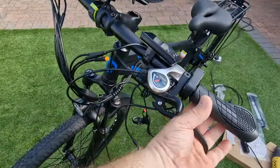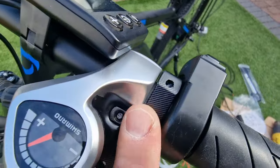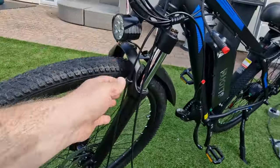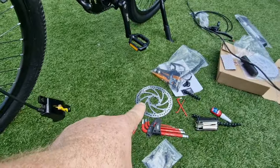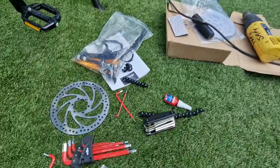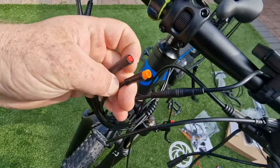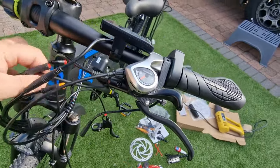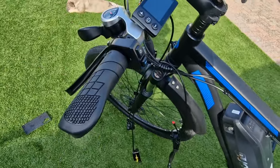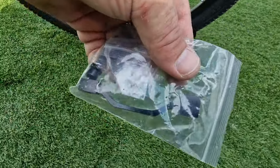It's really straightforward. We've taken the side off and put the new lever on — the lever assembly has a carbon fiber look, feels nice, with a really positive action. I have the spacer in the brake while I strip out the caliper. We've changed the disc rotor from 160mm to a 180mm wave-style one, which was quite straightforward — we loctited it on as well. About 20 minutes so far. I want to show you the connections: this red one is for the brakes and this orange one is for the lights and horn. We'll mount the new spacer because with the 180 we need to step out the caliper a little bit.